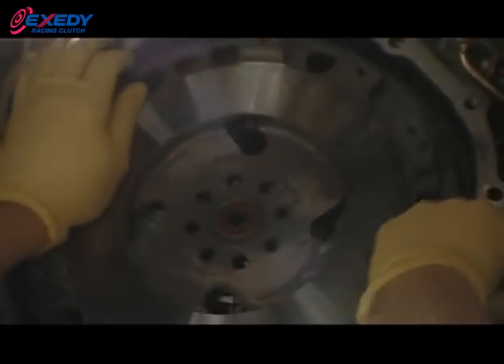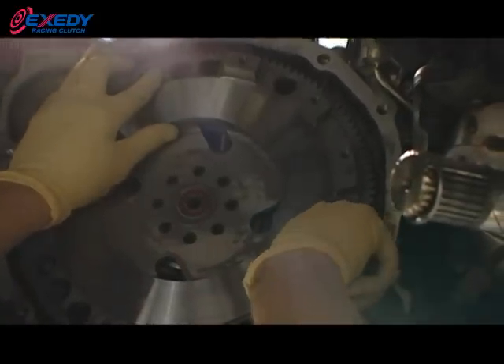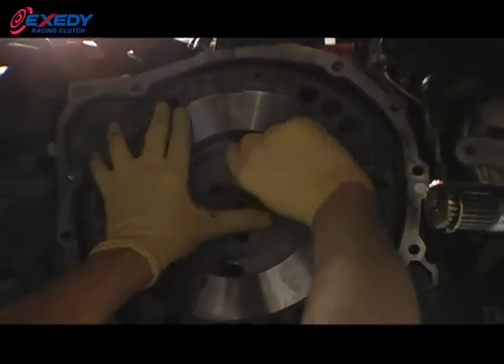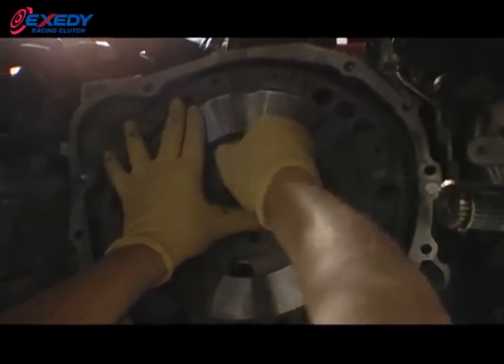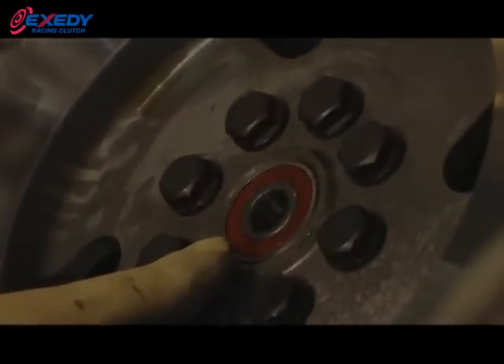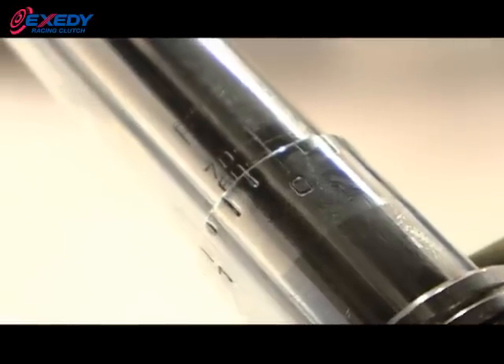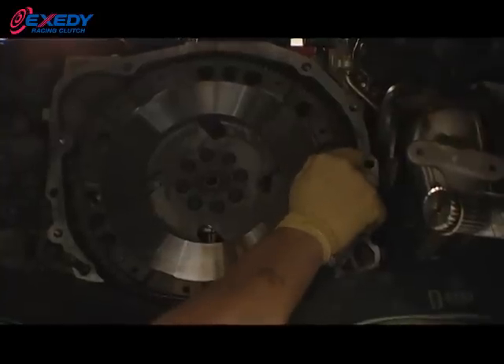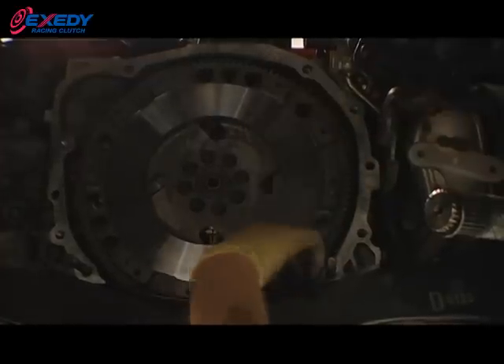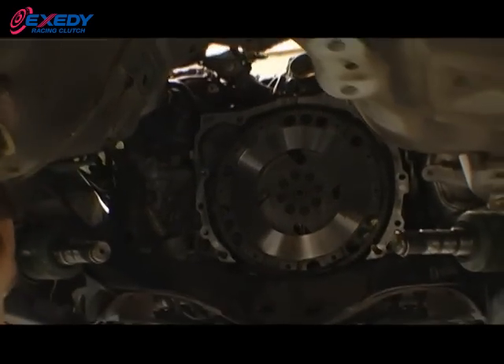Give it a pre-test run with the flywheel in place, making sure it's level and nice and clean. Remember, red Loctite is your friend. Apply a small amount of lube to the pilot bearing. Torque the flywheel down to 55 foot-pounds. Tighten bolts in a diagonal pattern on the flywheel and never use air tools to install the clutch cover assembly. After torquing all the nuts on the flywheel, shake it to ensure there's no play in the flywheel whatsoever. Give it another wash down, ensuring there's no grease, oil, or debris on the surface of the flywheel.